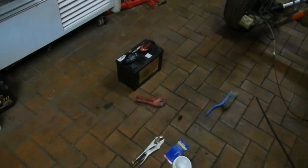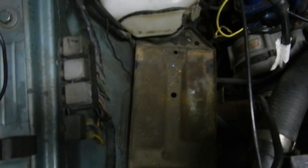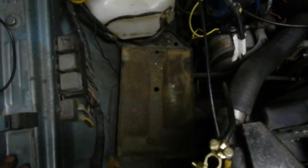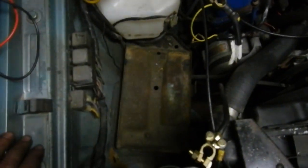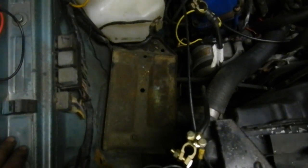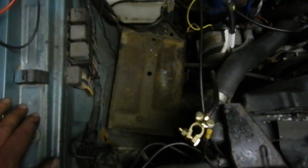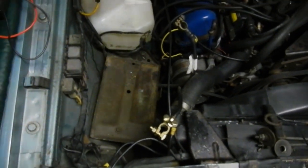I pulled that massive battery out — it's huge but only 700 CCA, so it's not the right battery for this car. You can tell because they've hammered it in and even torn through the skin just to fit it there, and it doesn't even sit on the battery tray properly. The battery's gone flat again — won't run the headlights, won't turn the engine over at all. It's running at about 10 volts, so I'm going to give it a proper charge and see if it comes good, but it's the wrong one for the car — I'll have to get the correct battery.